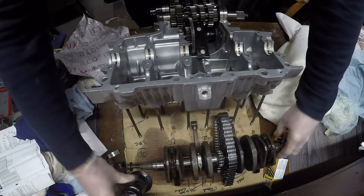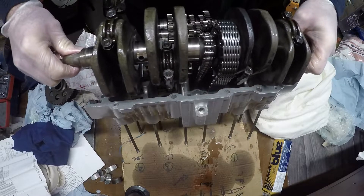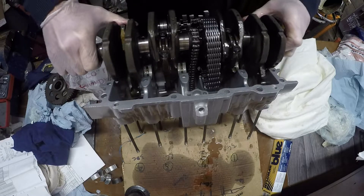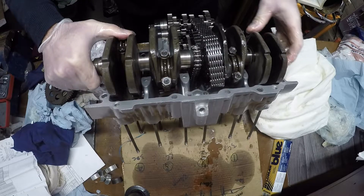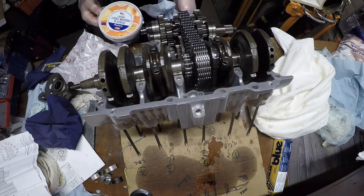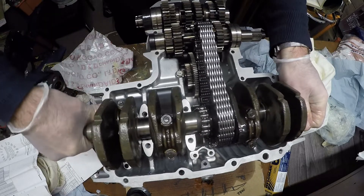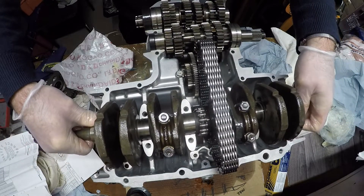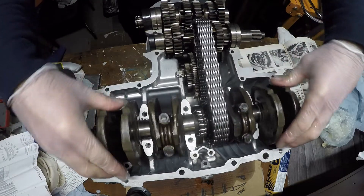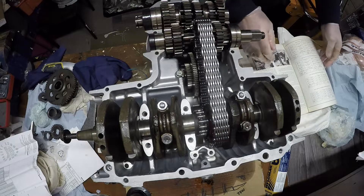It's been sitting there for a while. I learned that trying to put it in with the crankcase at this angle you can't really do it, because the conrods hit the case and you just can't quite line it up. I quickly learned that after fiddling you just need to put the back of the case up, and voila - reposition it and it drops in like a dream. It spins lovely.